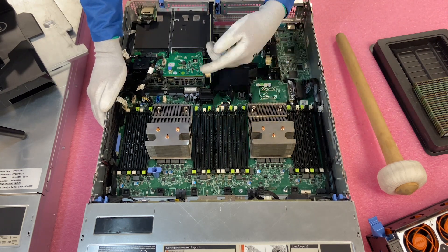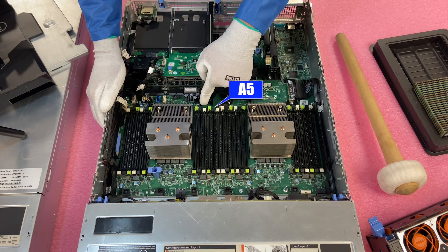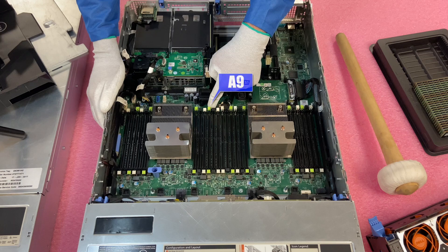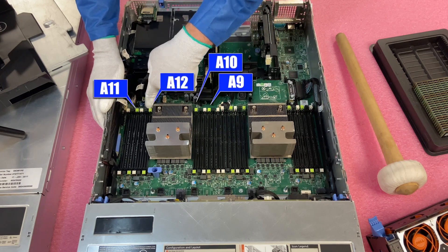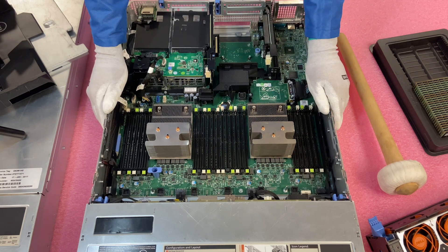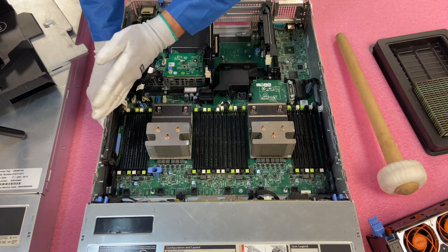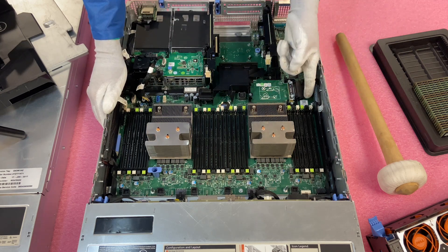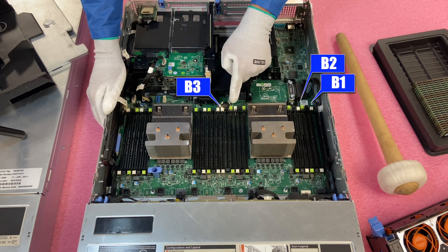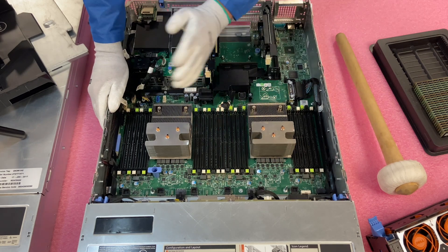Coming back around: A5, A6, A7, A8, and then A9, A10, A11, A12 — that's your 12 DIMM slots. For most users at home with two CPUs, if you were going to install eight modules, you would go through A1 through A4 first, then come over to B1, B2, B3, B4 before you touch any of the black or green slots. If you're only running one CPU, then you would start using the black slots and go to A5. So you get the general point.